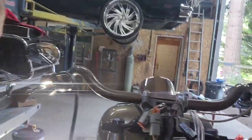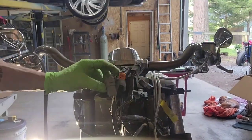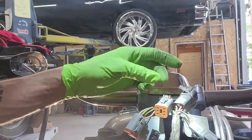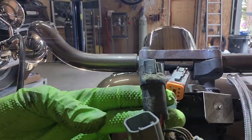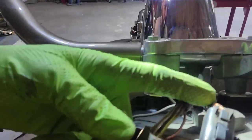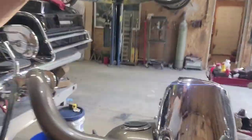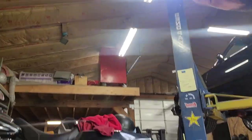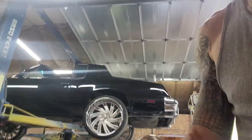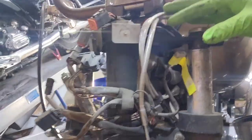This gray plug goes to the bars, this black plug right here goes to the bars as well. Here are the connection points to the bike — they only plug in one way, so just don't swap around the pins. We're gonna heat shrink and solder all these wires to the new bar since they're pre-wired. I did disconnect the battery first thing — always a good idea. Make sure you pay attention to the routing of the brake lines.